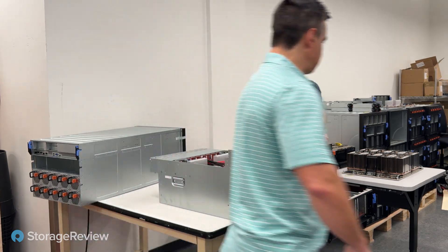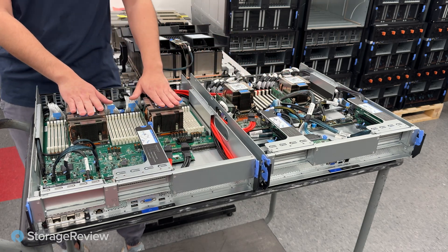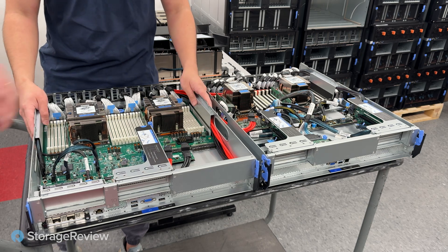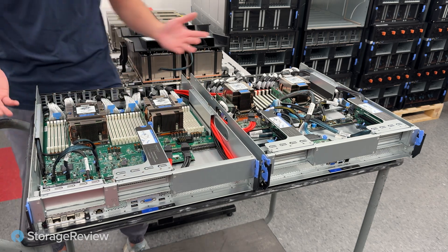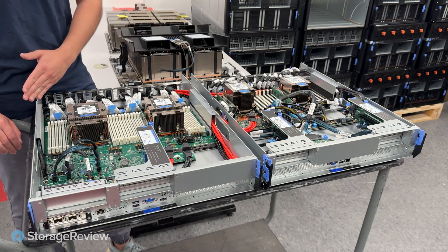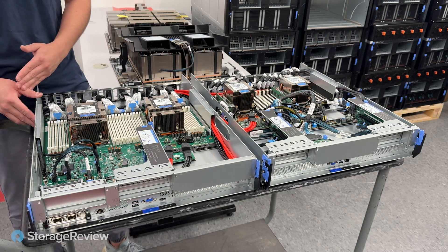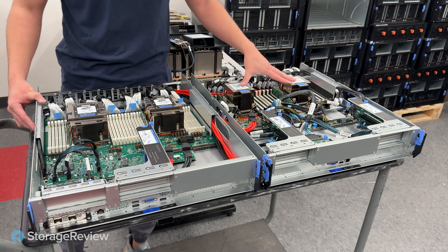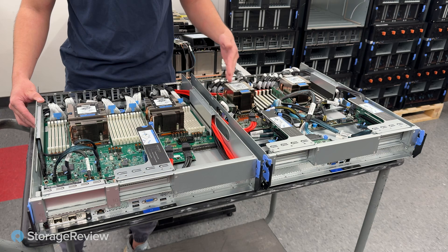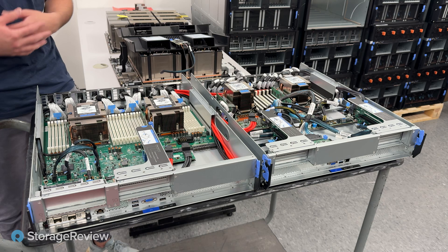With these pieces pulled out, we've got one with smaller heat sinks for Intel and this one is AMD. On the AMD one you can get 24 slots with 96 GB DDR5. On this Intel one we've actually got 32 slots — 64 gigabytes per slot, also DDR5 — so roughly around two terabytes of RAM.